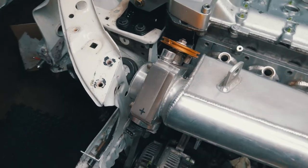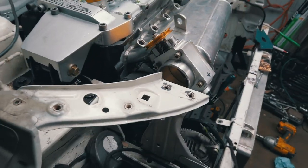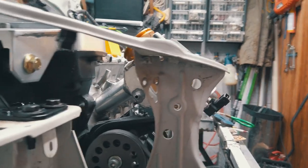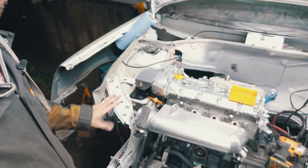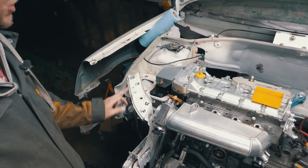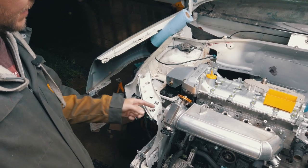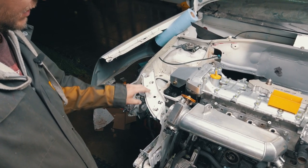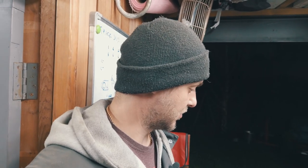Can you see anything? Anything that might be a problem in this setup? Anything? Can you see anything? Oh. There's a bit of metal in the way. We're gonna chop this whole thing off, and then just make a nice little space frame-ish bar that will also act as a support for the bonnet pin and also the headlight blanks. That's about it. As far as I know, it's not really serving any purpose. Plus, I'm going to be putting something back in there, so it should be good.